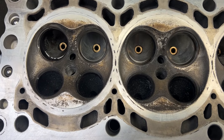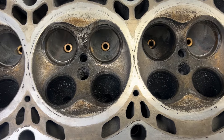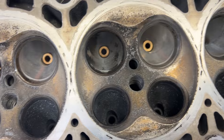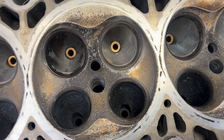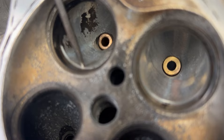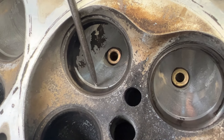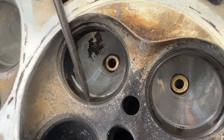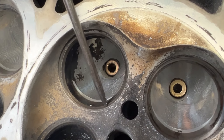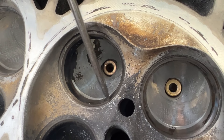The intake ports look great — I didn't see anything really to worry about, and the combustion chambers look like the car is running really, really well. What I did notice right off the bat is the valve job. This shop decided to do a valve job, said they were going to fix the HeadGames valve job, and I guess their way of fixing it is they made it one angle. There's no multiple angles here — only the 45-degree angle, and it's at the edge.